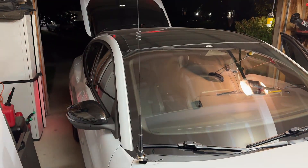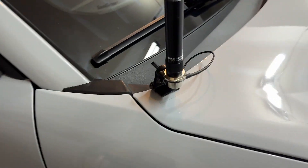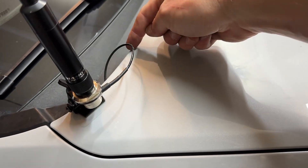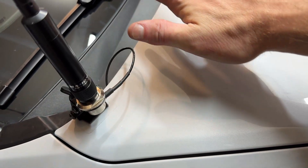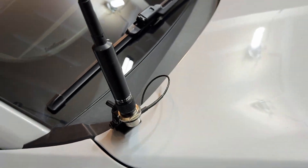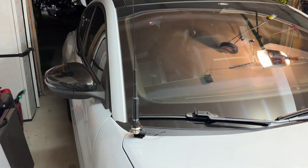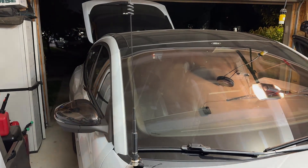It is buttoned up here, and I'll show you how the mount looks. The RS520 mount, as we talked about, is absolutely required for the frunk to open properly. So if you're wondering why I left this big loop, you have to have it — the hood slides back and it takes up that slack, so it'll damage your antenna if you don't. Again, that's the NR770B — great antenna for 70 centimeter and 2 meter, requires no ground plane, and gets excellent reception.